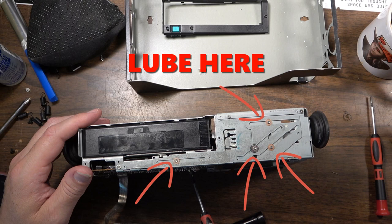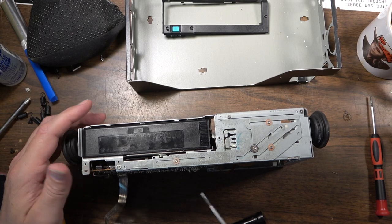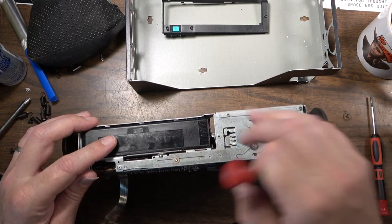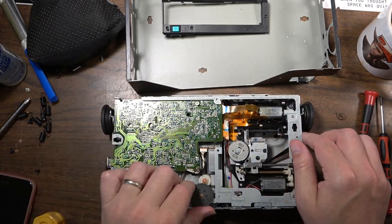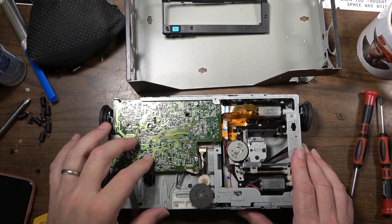Coming to edit this video it appears I've lost some clips, but essentially what I did was lubricate any bits that were metal on metal — this big armature and all this stuff just glides past each other. I also lubricated the rails on the sides of the chassis where the magazine lifts up and down. After lubricating every single bit of all of this, everything seems to be working just fine and consistently. If you have one of these doing what mine was doing — getting disk errors consistently — take the thing out and completely lubricate everything where metal is on metal. Thanks for watching, see y'all later.